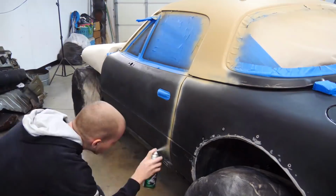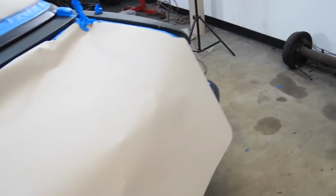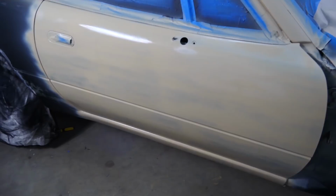I'm gonna go ahead and paint the doors now. Pretty much every time up till now when I was painting using these cans, it was on a horizontal surface. Painting on a vertical surface, well, runs. Whoopsies. This entire door is running, so I'm gonna have to re-sand this entire door. Frustrating, but hey, we'll fix it. This door turned out fine.